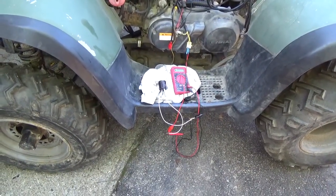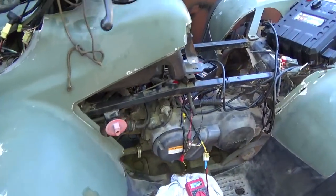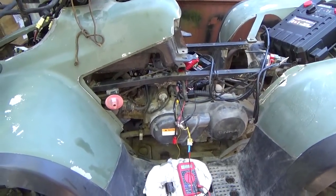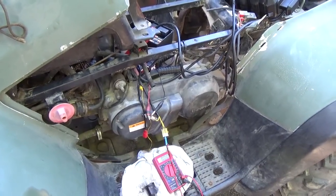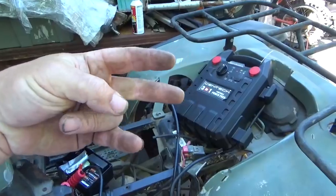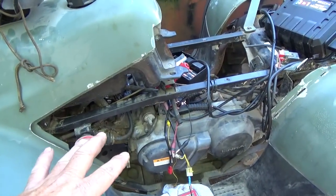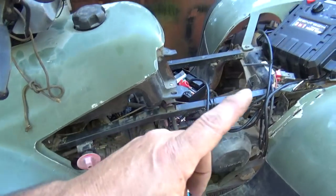Now it's a matter of troubleshooting backwards. They do things a little differently on this bike than I'm used to. The Hondas all have the ignition part of the bike as well as the DC part of the bike including the charging system. One side of it is at ground. It appears as if they have the stator here — the three-phase stator goes to the voltage regulator. Two leads come out of the voltage regulator and go to the battery, and the positive or negative lead goes to the engine. But no part of the AC circuit for charging the battery is at ground — only the DC.